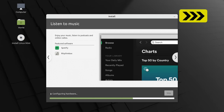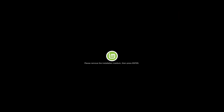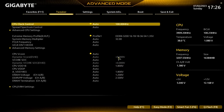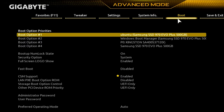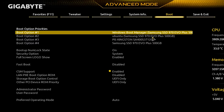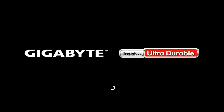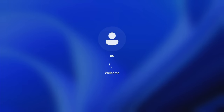Installation is completed. We restart, remove the USB drive, and the computer reboots. Going into the BIOS by pressing Delete, I strongly suspect — and yes — Linux has set itself as the first boot option. I'm going to change that back to Windows as first, Linux as second. Saving and exiting, the machine reboots and boots directly into Windows without showing a grub boot menu.